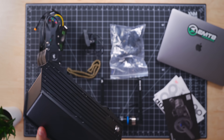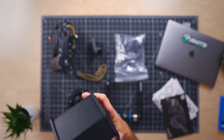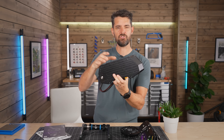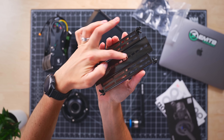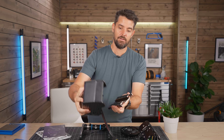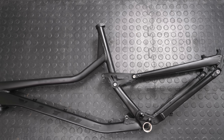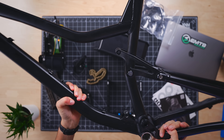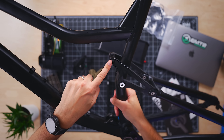The other thing needed is a battery. They even make their own, or you can get one built for you by a specialist, but I got the CYC battery — 420 watt hours, weighs about 3.2 kilos, and it's just going to bolt into the triangle of the frame. There's a little plate that goes into the bottle holder of your bike with mounting screws and holes so you can screw it right in. The donor frame I'm using is from Vitus — the Mythique — a full suspension bike, but you can use pretty much anything, hardtail or full suspension, that you might have in your shed. Let's build an e-bike.